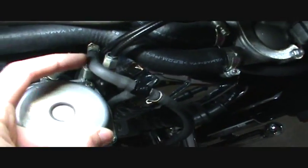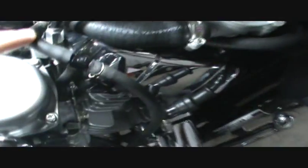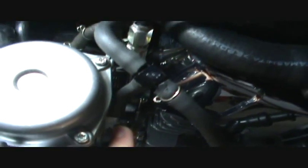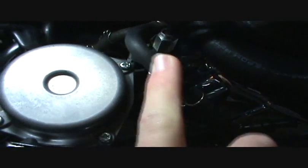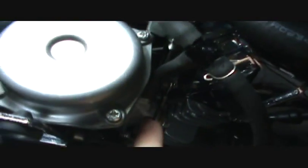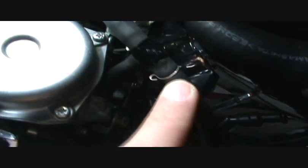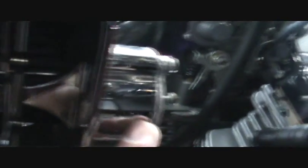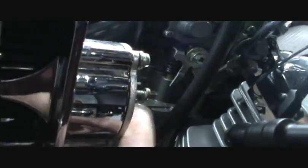After I did that, I had a longer line running right here, going straight directly to this port right here. Then after some thinking, I took this line, cut it, put a T here, ran a short line to this port, then had my regular vacuum line run up over here and to the bottom of my hypercharger. This little diaphragm right here has a vacuum thing in there with a rubber seal, and it's got a spring tension where you can let it release to get however much vacuum you need.